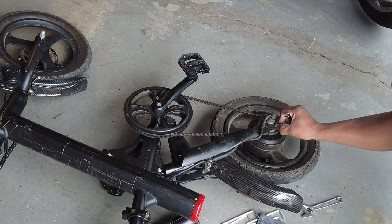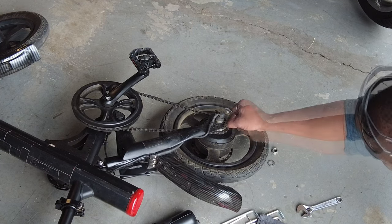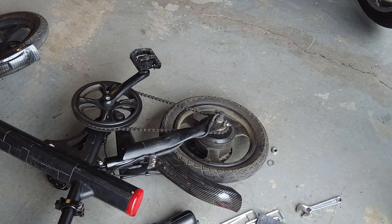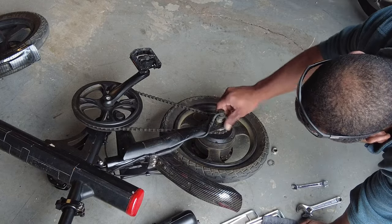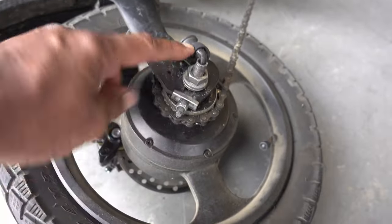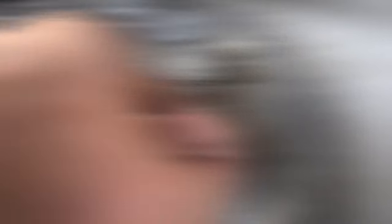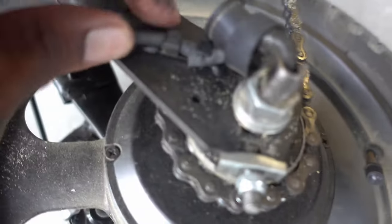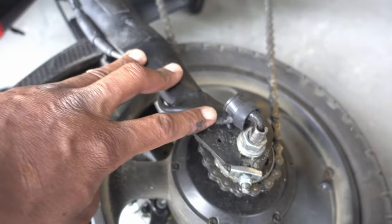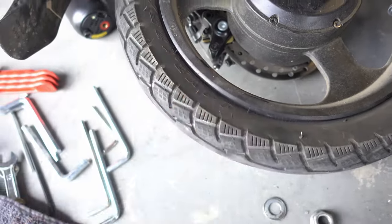Now this side is the side that has the chain as well as the electrical connection to the hub motor. I've got to be careful when I take off the hub motor to remember the electrical connector and how it goes back on. So make sure you take the boot, put the boot back away this way. Loosen the retainer on both sides. The nut on this side with the electrical connection is actually hollow — the axle. Also be sure to route your wire around these two holders here, and the chain on this side. The disc brake on the other side will also have to be negotiated.